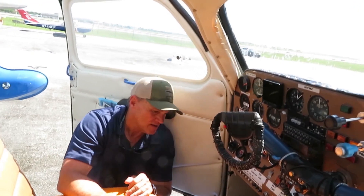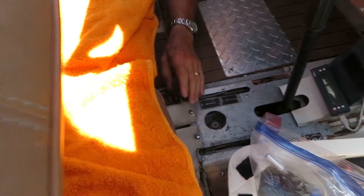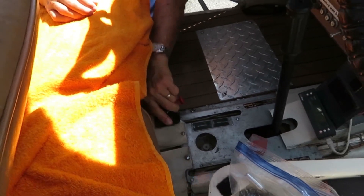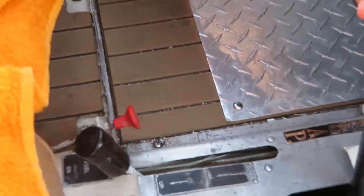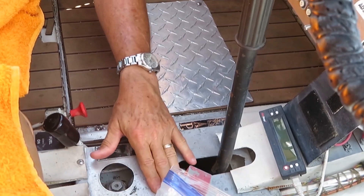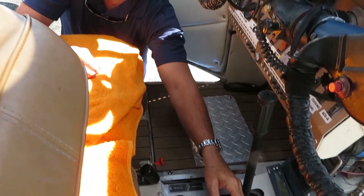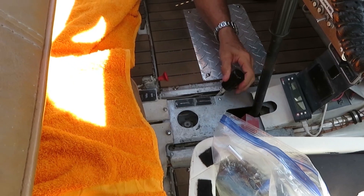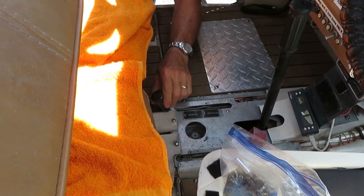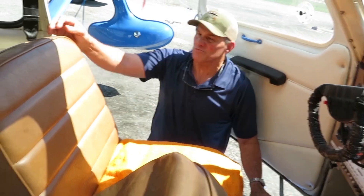What's also unusual is that the hydraulic system uses just one little tank. This handle runs the hydraulic pump and allows you to bring the gear up and down and move the flaps up and down by simply making a few changes to the switches — flaps go down here, flaps go up back here. It's a very simple, elegant design that lasts forever. That's what you're looking for.